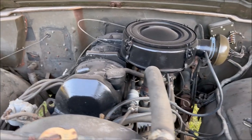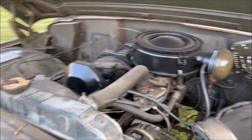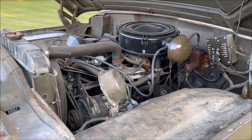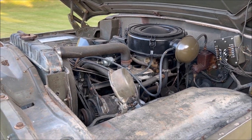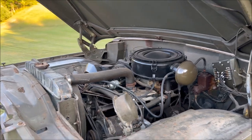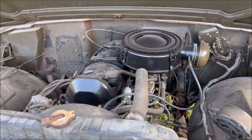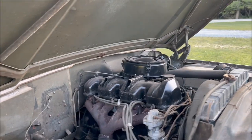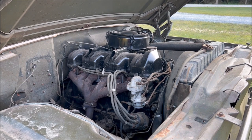It had a tendency, if you over-revved this motor quite a bit, it would starve the number six cylinder and destroy the cam. The military corrected this in 1968 by having Kaiser Jeep put a governor underneath the carburetor, which restricted the total RPMs to keep people from over-revving these. After that, it corrected all the problems. But by then these had developed a reputation within the military that they were a finicky and hard-to-deal-with motor, leading to just the short lifespan of the contract period - only a three-year contract from 1967 through 1969. After that, the U.S. government moved on to different and better designs.